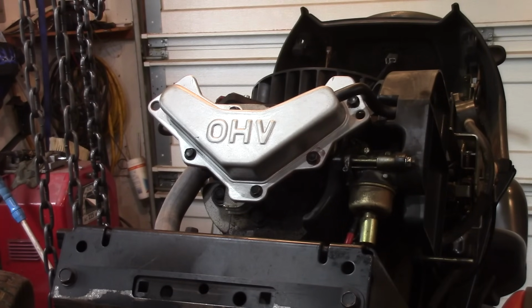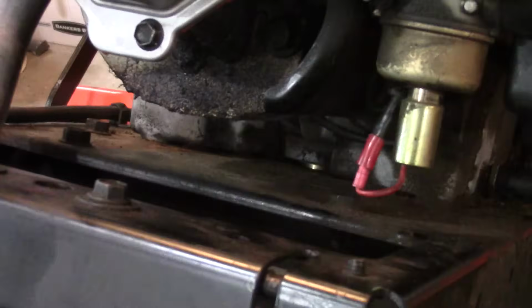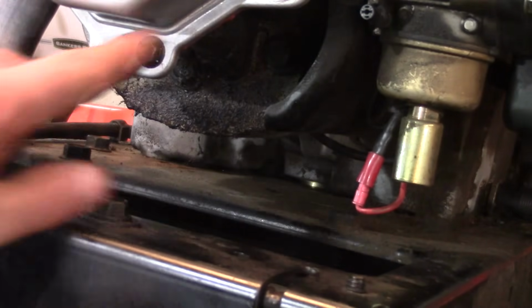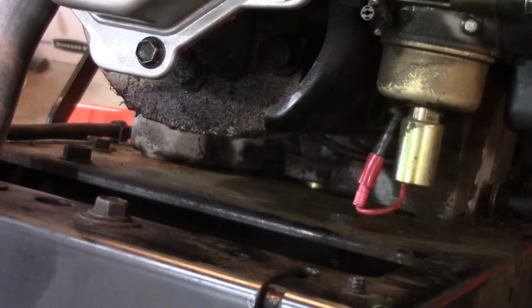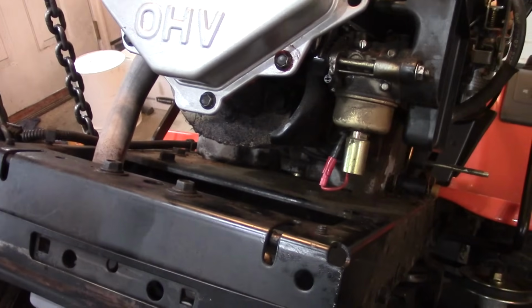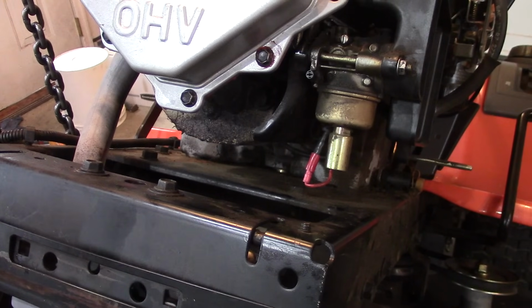That's the called for repair here without the cork gasket. And as I said, the problem with the cork is that oil will soak into it. It'll absorb it. So that's why the cork tends to fail and doesn't last very long. Another thing that you can do to help prevent this thing from leaking is add a little heat shield here to help prevent the heat from the muffler getting up here, because they usually leak on the bottom. So that's something that you can do if you're often replacing the valve cover because it's leaking, or the gasket I should say.